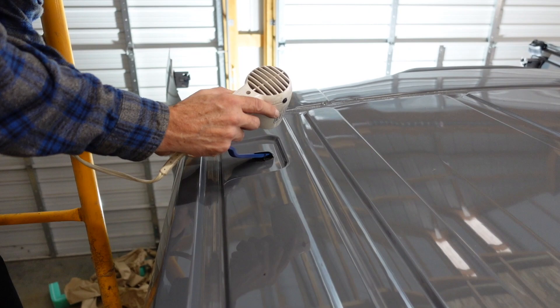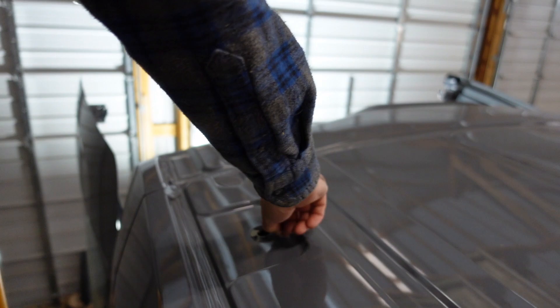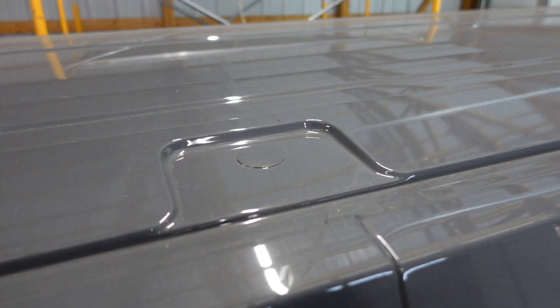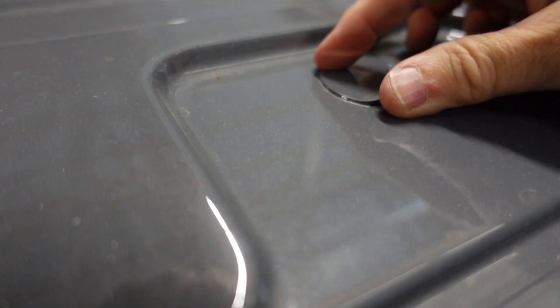We still have to take this stuff off. The hole is not lined up - that's supposed to be very common in these, so we're going to have to trim the metal back and then repaint that part. Just a little piece of advice I've come to realize in taking some of these off: don't heat them. Heating them makes them come apart and leaves more rubber. If you don't heat them, once you get it up a little bit, just pull it off by hand. See how much cleaner that is?